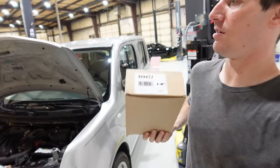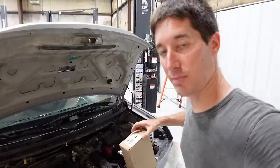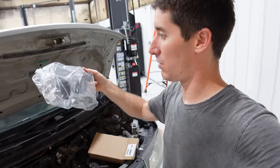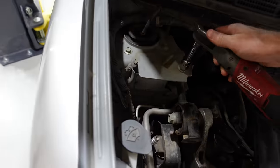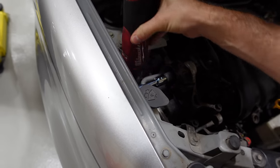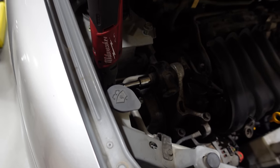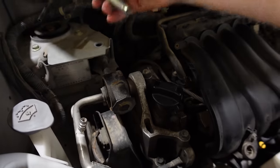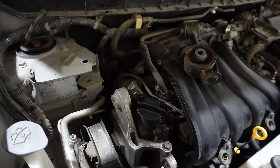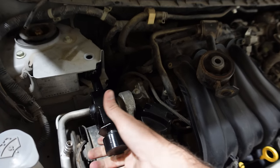From O'Reilly's we have the B9422, which is the upper torque mount, and we're going to throw that in right now. A brand new battery went in today too - the right battery, because the other one did not fit at all. There are just two 18mm bolts holding this mount - one here and one there. Getting number two out one-handed is not possible; it took a jack handle on a half-inch ratchet. Now we're wiggling our new one in, line up the hole, toss it back together.